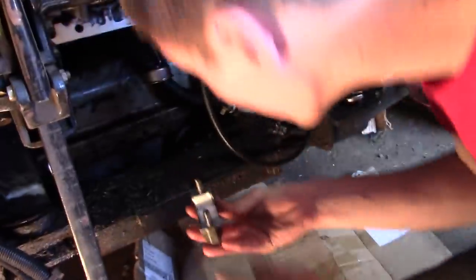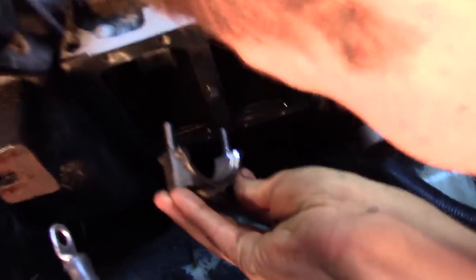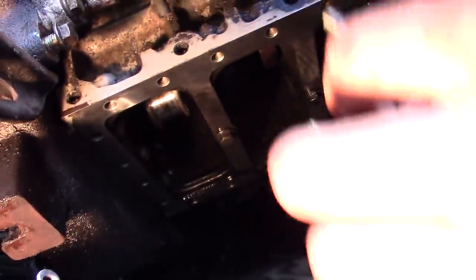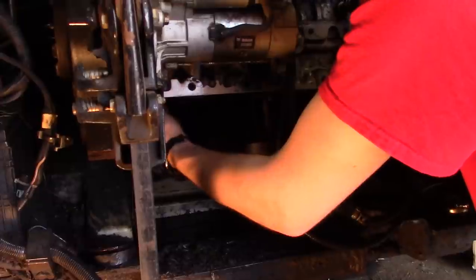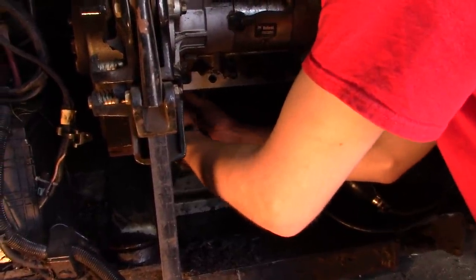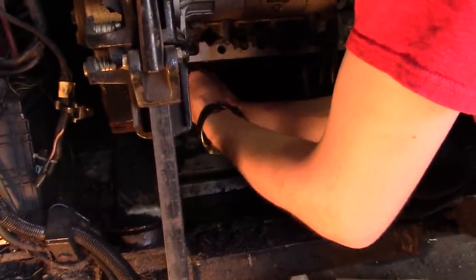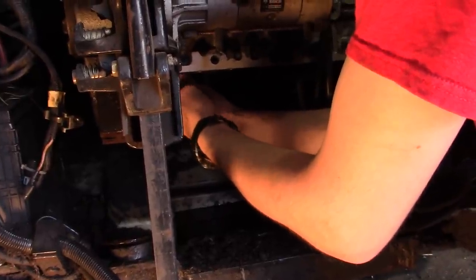So to do that — you're not even going to be able to see this because this engine, the crank is set so far up. But I've got everything cleaned off already up there. I just torqued the rod cap to the proper torque, 36 foot-pounds. And I'm loosening it back off and we're taking it back off. We'll see what the PlastiGauge has to say.